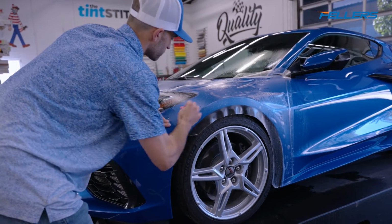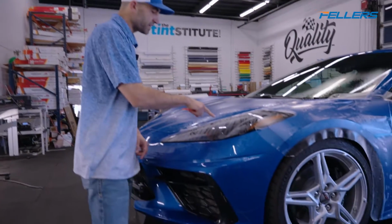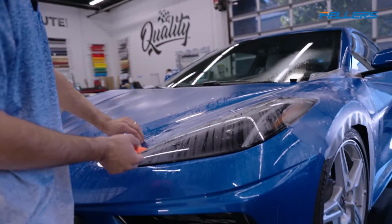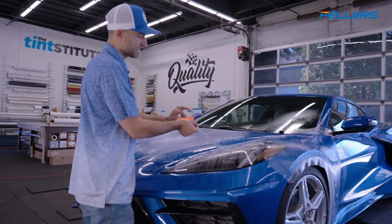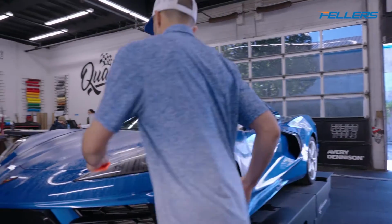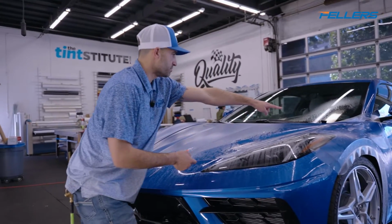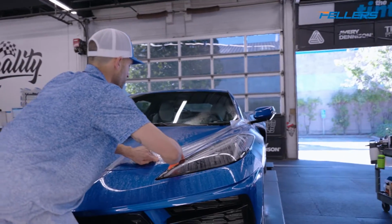Now I can tack that down using my Trex PPF squeegee. Okay, there's a little finger right here that I just created. So I can either work this out, which is possible, with a little bit of tack solution, or because I ceramic coated this fender, I can easily, see that? Easily lift this back up without creating any work mark, using my standard slip solution that's in my True Spray system. And look, this is all still smooth. I just need to pull that out right there. Boom.